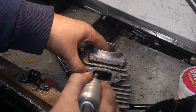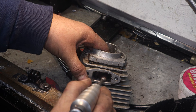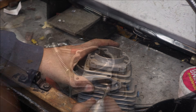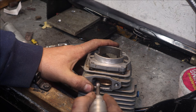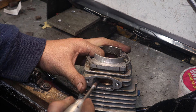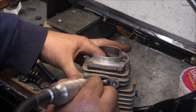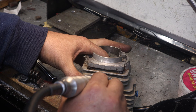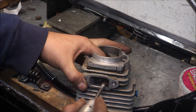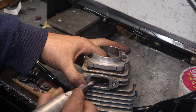I'd like to add that when I do these videos, this is not the whole process — I'm just showing you a ballpark of what's generally going on. This was all filmed over the course of close to a week. I took the saw apart one evening, came in the next evening and done the machine work and dialed in the squish. The following evening I did the exhaust port and intake port. The next evening was spent grinding the upper transfers, dialing them in, and finishing up the cylinder. Then the following evening I put the saw back together, and today I put it in a piece of wood and got her dialed in.